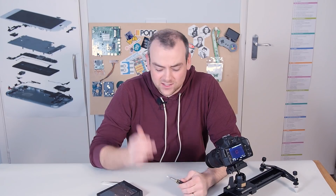Just while I tidy up, I wanted to address a comment from YouTube regarding the fax machine episode. Somebody called Bruce A, who appears to have worked for a fax machine manufacturer, made a clarification. That dual-layer scenario behind the buttons was actually designed so you could use the analog side of the phone even during a power cut — the analog side draws power from the phone line, so you could make emergency calls even when the mains power was off and the digital fax machine side was off. Thank you, Bruce A — makes a lot of sense.